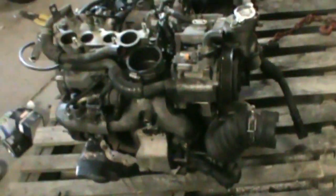I'm just going to start over here on the turbos. First thing to come off is going to be the air pump — there's a bolt at the bottom and one at the top, nothing big. I'm just going to pop those off and then unbolt the Y-pipes. You can see the bolts where it bolts onto the turbos, just to get that stuff out of the way.